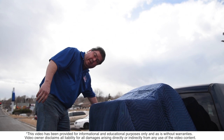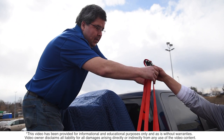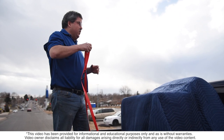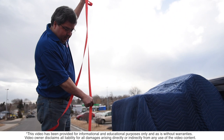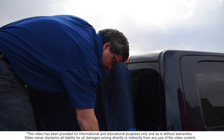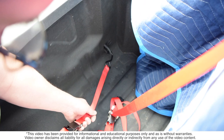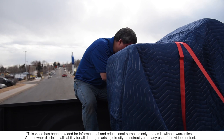On the front this strap can move and slip, so for washers, dryers, ranges, and dishwashers, I'm going to put both tie-down points on the same side, hook it on, and run it over the top. I want to avoid being up against the control panel if at all possible, because if you over-tighten you're going to start bending the unit.